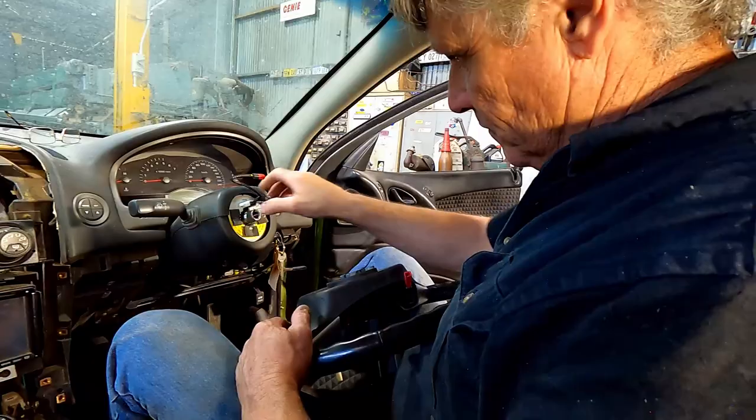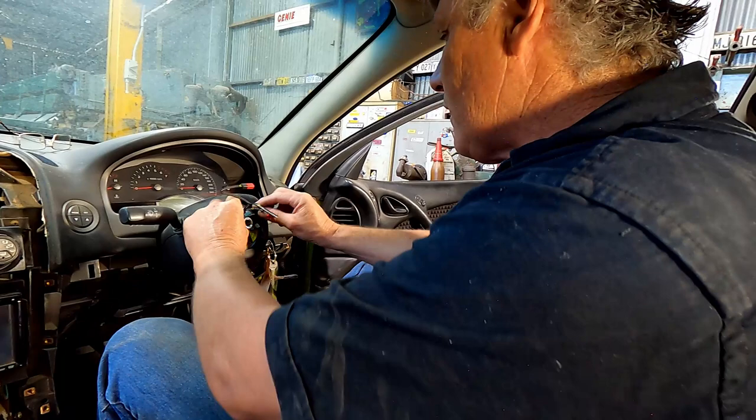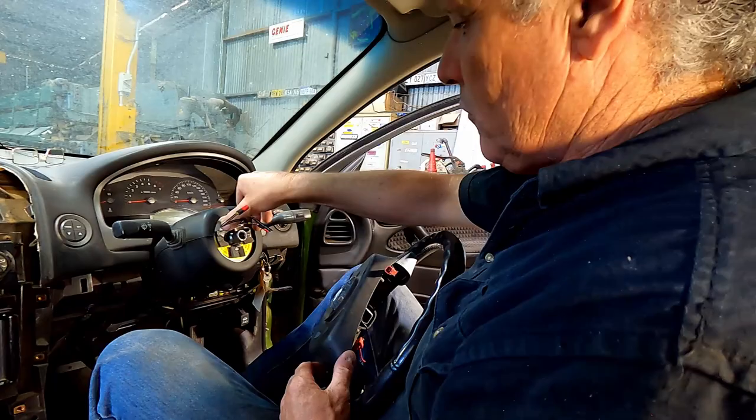This clock spring is not locking in the straight-ahead position. So it could be what GMH says — they are a throwaway item. It has died. They've got these little legs in here but this one doesn't want to lock. When they're spread they hold it straight, and when the steering wheel goes on they just push in and tighten that up so the whole spring can turn.